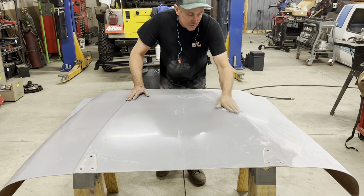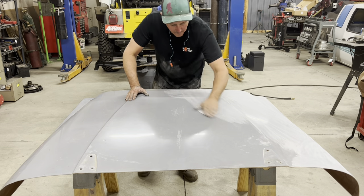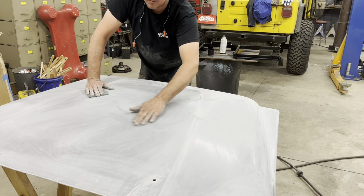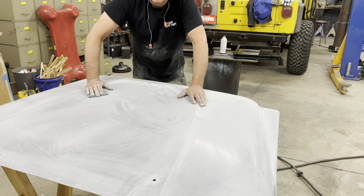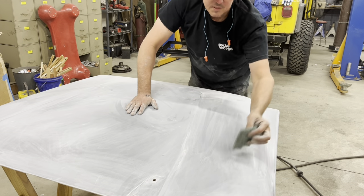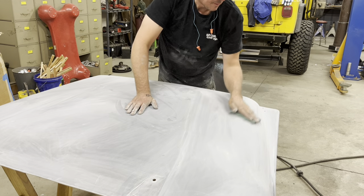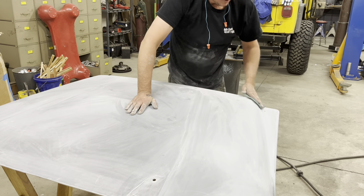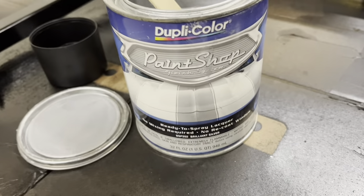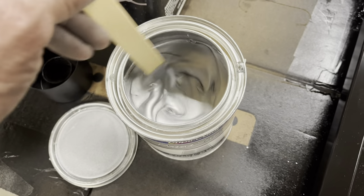So the plan here is to scuff this thing up so that it doesn't have any more shine or gloss to it. I used 400 grit sandpaper first and kind of got the big stuff off and now I'm going over it with some Scotch-Brite. This is green Scotch-Brite, which is not what you really want — you want the red Scotch-Brite. That stuff seems to work better for auto body prep, but I don't have any so I'm using this. I'll get this thing all scuffed up and then we're going to shoot it with a silver base coat. This is Brilliant Silver Duplicolor Paint Shop.